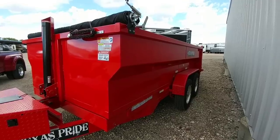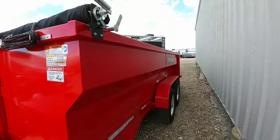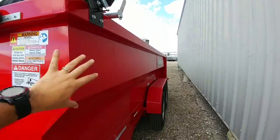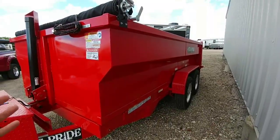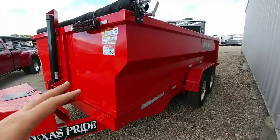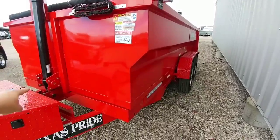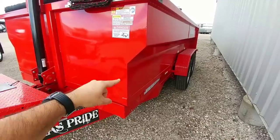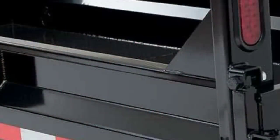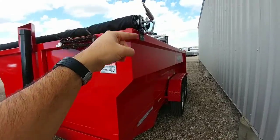Let's first start by taking a look at the top rail — this piece of steel right here. A lot of people that look at trailers fail to look at that specific piece, mainly because they see reinforcements and things running down the side that look structural. But they need to understand why trailers are made certain ways. Some brands claim to use a solid floor where the seam goes down the center — they take the bottom floor, the flat piece of metal, bend it up and over the top and around. So it appears as if there's a top rail, but in fact it's simply the floor transitioning to the side, bending over and then back around.